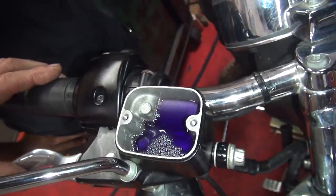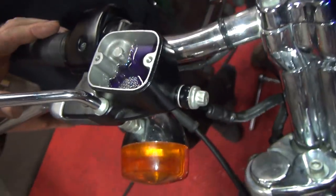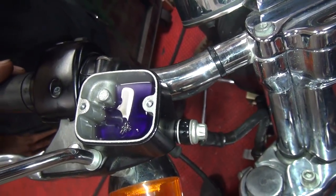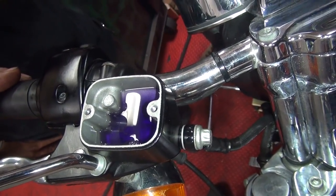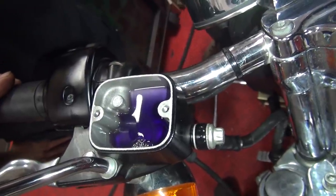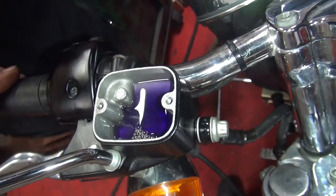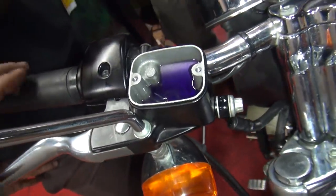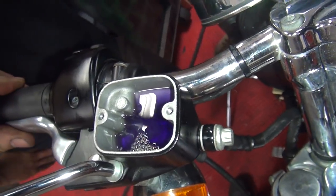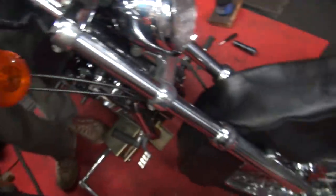When I leave and I come back, there's more air in the system. That's because it has to work its way up. You can see how much it comes up. See that nasty filthy crap coming up in the hole? That's all the dirt in the lines. That's all the crap we didn't clean out when we cleaned it. Did an inferior job. I remember you saying a little dirt never hurt anything. It's brake fluid. I think it said Harleys don't care about a little dirt. It has built-in clearances to compensate for all that crap.